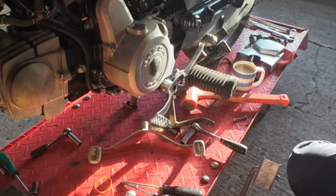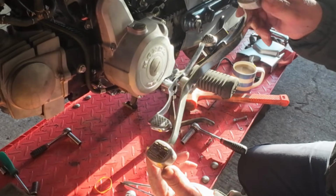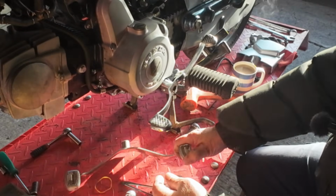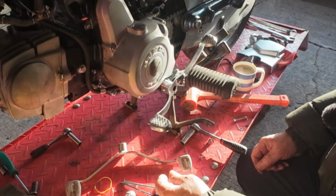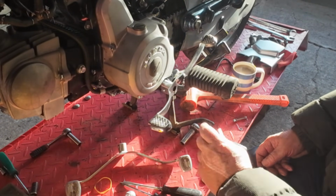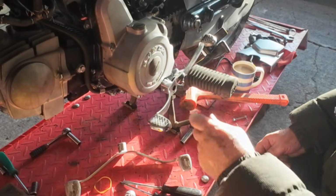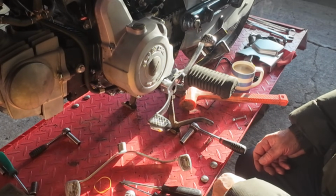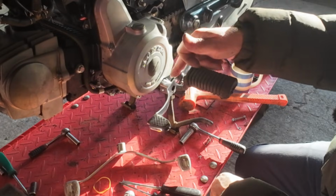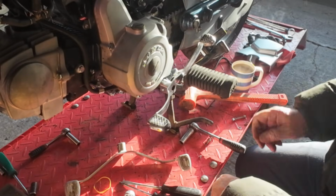So we've hit a potential issue with the gear shift. My C125 gear lever that I really like won't fit anywhere near. It fouls the footrest bar. So I've got the original out, and that won't fit either. So something's changed on this engine. It looks like the gear shift shaft is like an inch longer than the old one. My last Lifan 110 I had, there was no issue here, no issue at all. Don't quite know what we're going to do about that one.